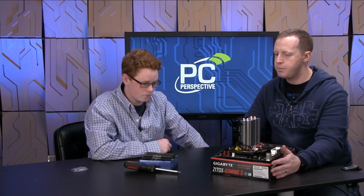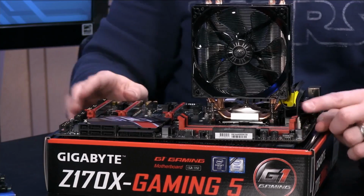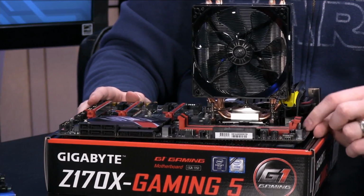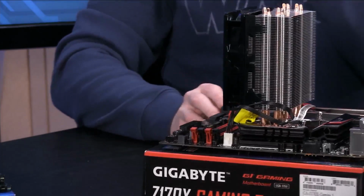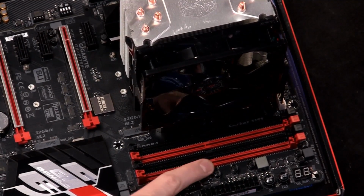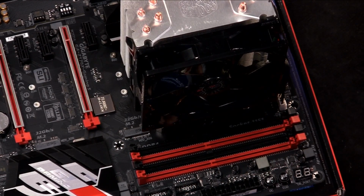Now this installation process is pretty easy. As we look at it here, you'll see a couple of things. One, if you look at this side of the memory module, it's kind of fixed. But if you look at this side of the memory module, you have these arms, right? And these are what will lock memory modules in place. Also notice, if we look at the overhead, that there are keys here. And by keys, I mean there's a little notch, right? See how the little notch is there? And you notice that this is a different length than this length.